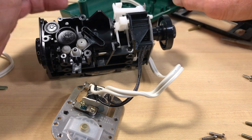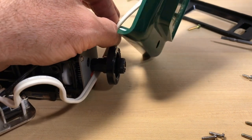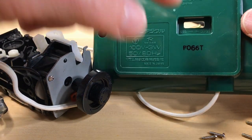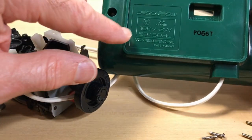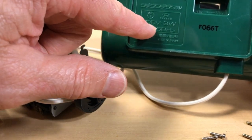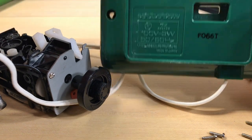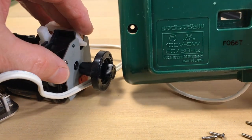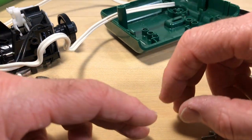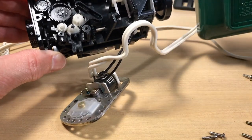We had to break into the previous video — I was going to do a straight run through but I knew people would be interested in what might be causing that humming. What you may or may not have noticed is this clock can be set to run at either 50 Hz or 60 Hz, which is very common for Japan. Clocks made to run in Japan run at 100 volts; half the country runs at 60 Hz, half at 50. This was actually made for Japan, but you can run it in the United States without any problem.